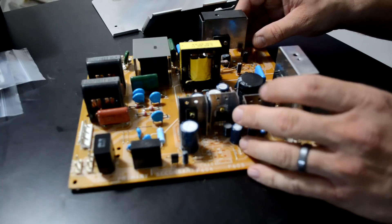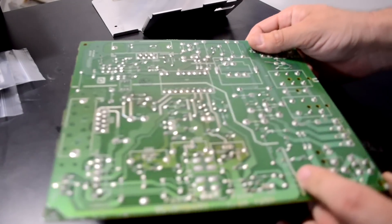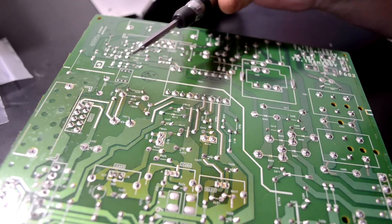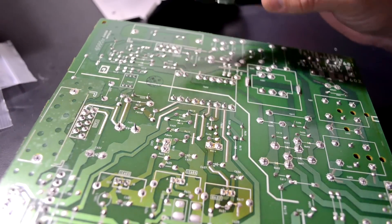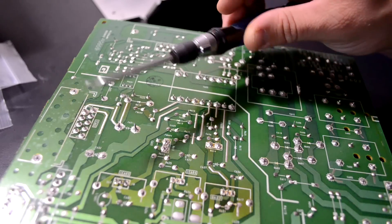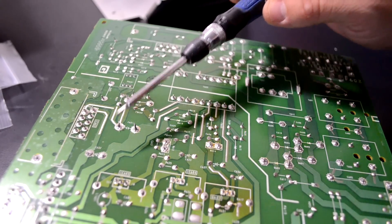Before we go any further, let's talk about something real quick. I want to discharge this capacitor, so I'm going to flip it over. You can see the leg prongs on this side — this is the big capacitor. This is not technically the 100% correct way; you could use a multimeter or a resistor. But just to do it the quick and easy way, I'm going to discharge it with this screwdriver by just tapping these two leads together. We might get some kind of reaction. This screwdriver has a rubber handle and the tip is separated from the handle, so I won't get shocked.